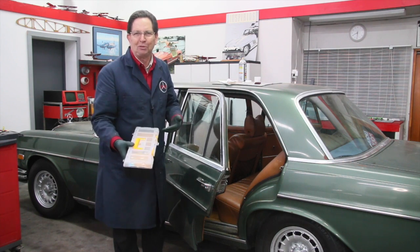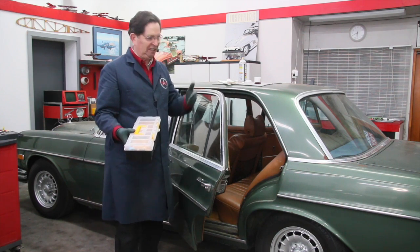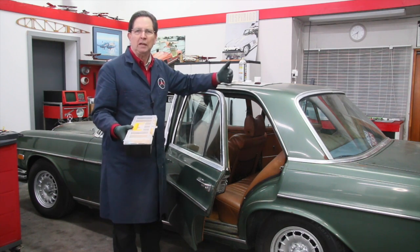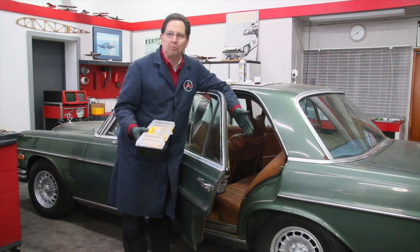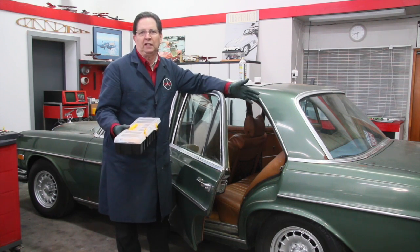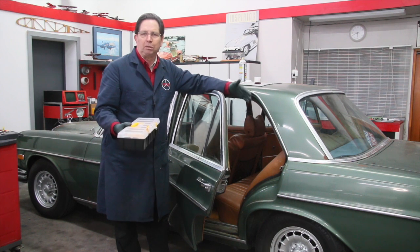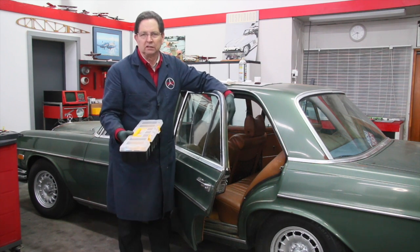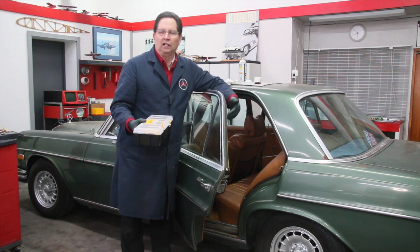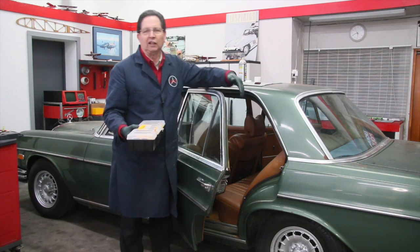It has every lubricant in here that you're going to need to do this kind of job, and then just go through each door, get the panel off, clean everything up. Make sure if you have the panel off and that plastic liner's damaged, make sure you either replace it. You can use visqueen, heavy mil clear plastic, and remake one of those plastic liners if you have to, and use spray adhesive, spray glue, to go ahead and re-glue the plastic on inside the door.